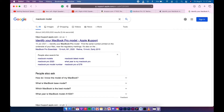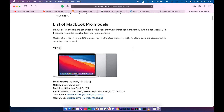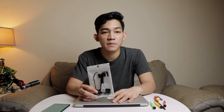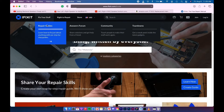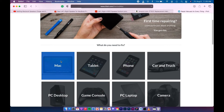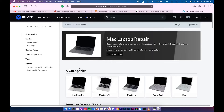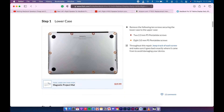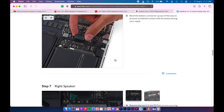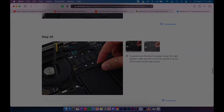Another tip: make sure to indicate your model number when looking for replacement parts. For the 13-inch 2015 Retina MacBook Pro, it's A1502. I'll put a link in the description to the Apple site where you can find the model number for your particular laptop. I won't go into the details of how to disassemble this MacBook because this problem isn't unique to one model. Instead, I highly recommend going to iFixit.com for guides specific to your MacBook — the guides there are better than videos because each step, tool, screw, and detail is listed with photographs.